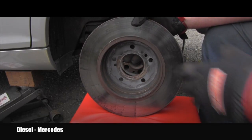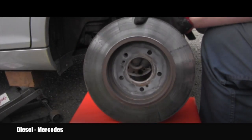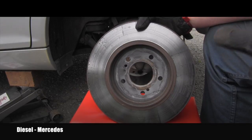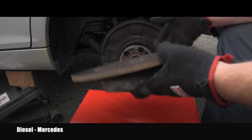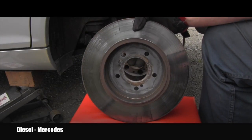Another detail about this rotor: look how nicely worn it is on one side, but when you flip it, it's already way worse — there are heat spots on it. So if you're inspecting something, don't just look through the spokes of the rim or only at one surface. If you pay for an inspection it needs to be detailed, and all surfaces need to be inspected.